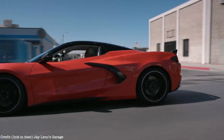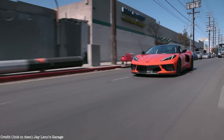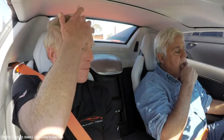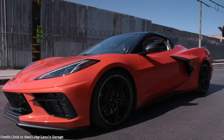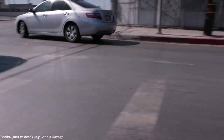It gives you a good idea of how powerful it is and how quick the transmission responds. It just shifts with such quality — that's what I dislike about torque converters, that weird lag, whereas this is literally just bang bang bang, it feels like quality. Even city driving, just creeping around in idle creep, it feels like a fluid torque converter. It's a lot — it's essentially a manual transmission with wet friction clutches — but it's very smooth off the line and the gear shifts are real smooth at low speeds.